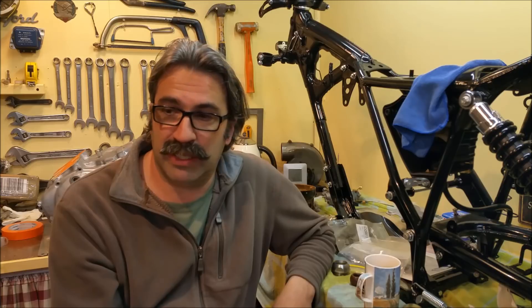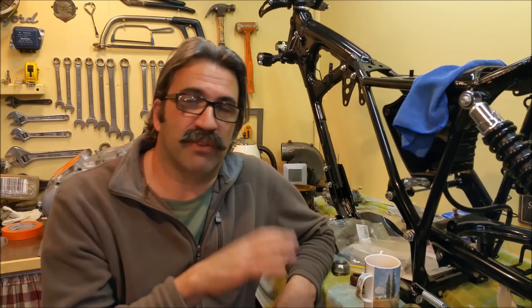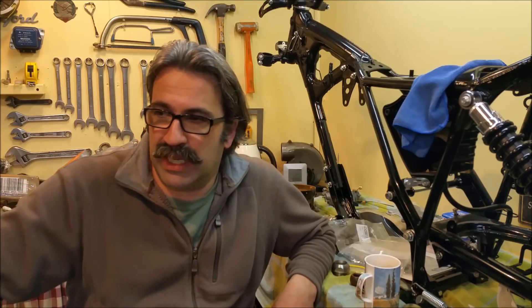The problem with the doors and the boot on this car is they're full of blisters — humidity blisters. And they have to go back to bare metal, just so we know exactly what's underneath. Because anything like a humidity bubble, or crazed paint — paint's not stable. You cannot do anything with that. Can't paint over it, you wouldn't dare. So they have to go all back to bare metal and we start again with them.